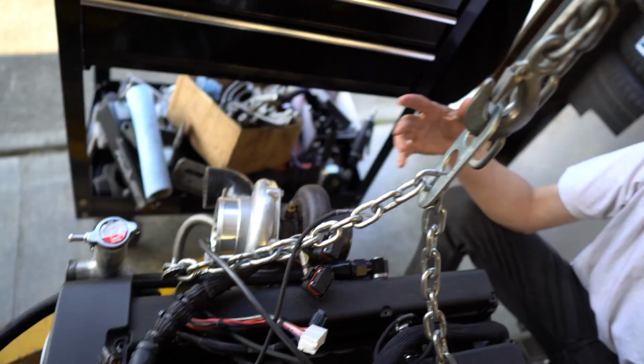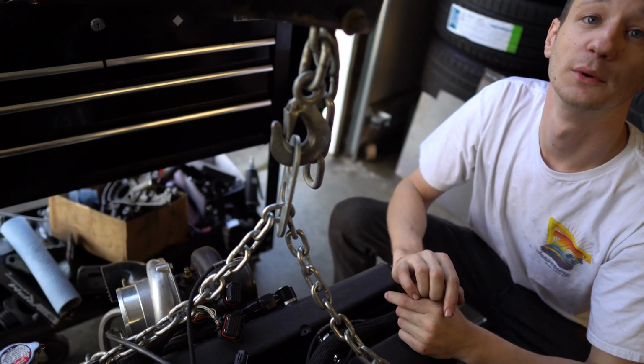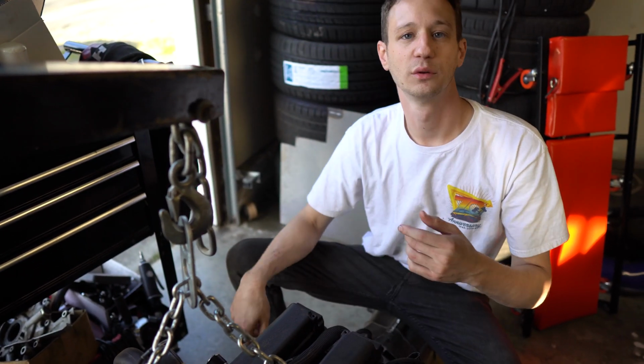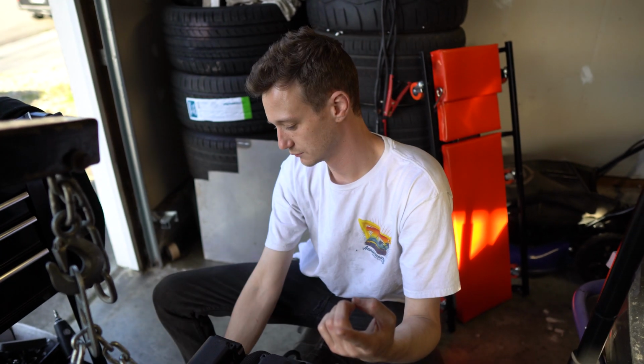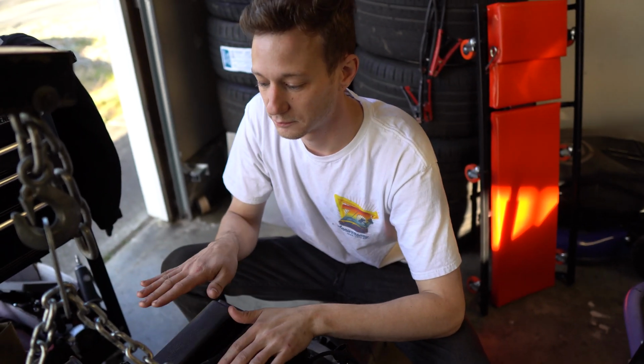So I'm waiting on the stuff to do the turbo lines. I'm doing water cooling on this turbo this time. Previously, I didn't run water cooling on the turbo. Because you had a Borg Warner. No, because I had this turbo, but I just didn't run the coolant ports. So I cleaned it all out. You did have the Borg Warner that is an oil feed. Oil, yeah. So I'm water cooling the wastegate, water cooling the turbo, running it all back in. I got all the lines ordered last night, so everything is ready.